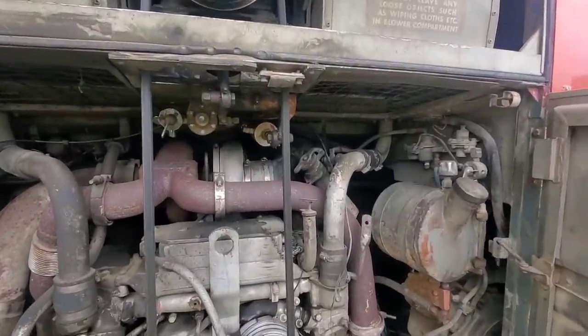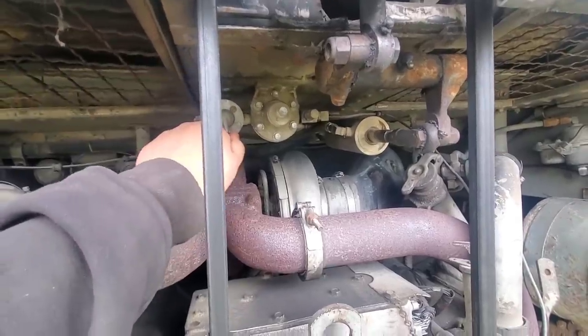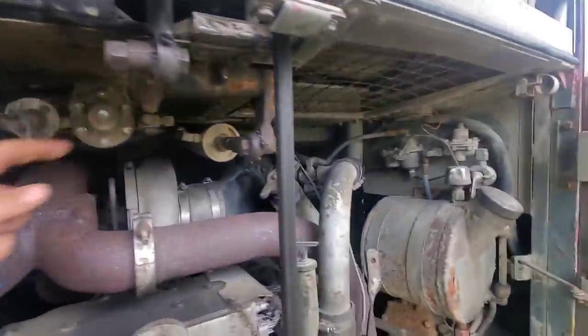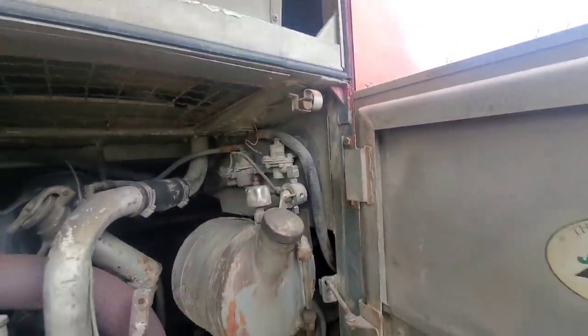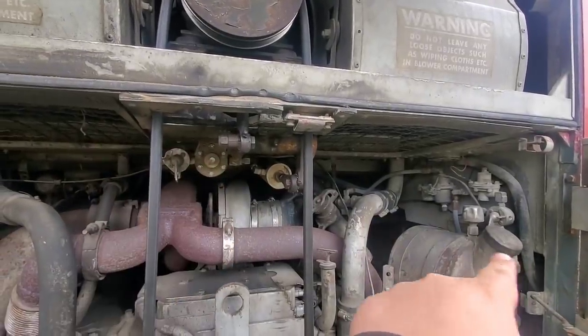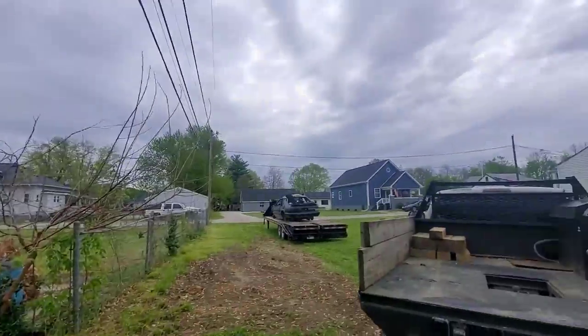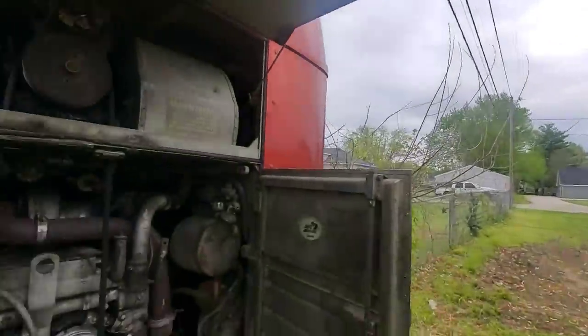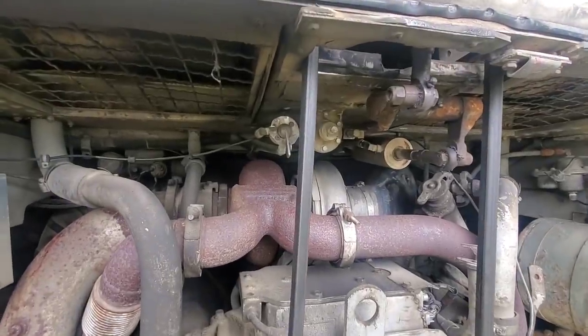Getting started on the MCI. We've seen before we've got a pretty good air leak out of this valve. This regulator is leaking and this valve is leaking. We just got the parts in from Luke at US Coach to rebuild both valves and the diaphragm. I got my truck backed up over here. I'm just going to get started on getting these apart, get them on the back of the truck and get the rebuild kits out and we'll go through them.